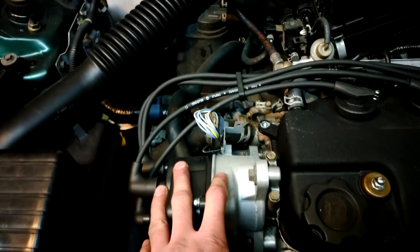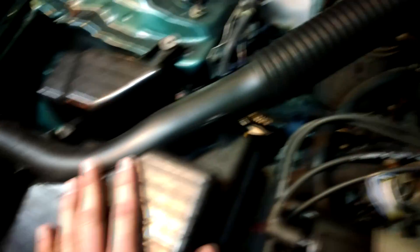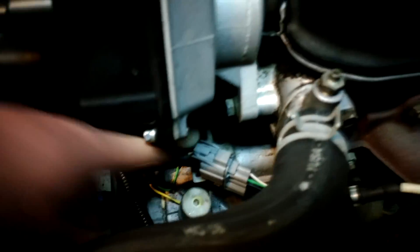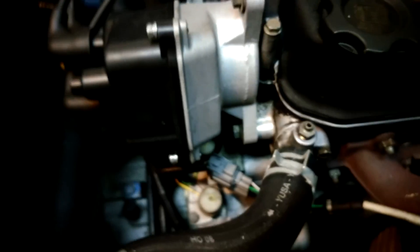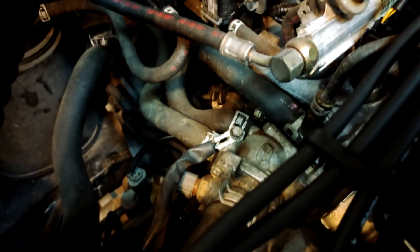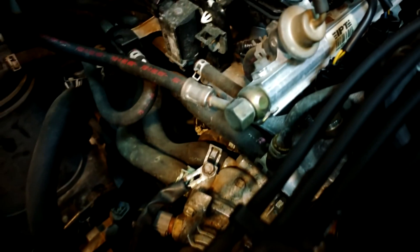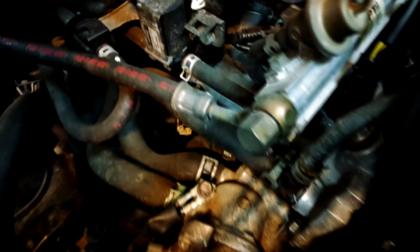You run your OBD2 distributor — this is the one that came off the old engine that was bad — while running the Y7 manifold. You need the Y7 airbox, so all that's like stock. The only other sensors on the block would be the two under here: the coolant temperature sensor for the ECU and the single pin one for the gauge cluster. Back here is normal, that's just the water pipe. I did have to plug off one line — I think it was an extra one for the throttle body. I used the stock Y7 intake manifold gasket.